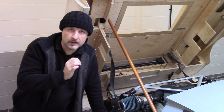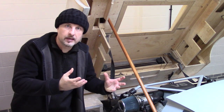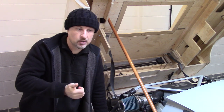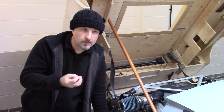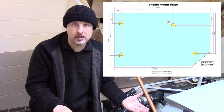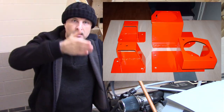One of the things I had to figure out were the engine mounts. To make this modular, I couldn't weld the engine mounts into the chassis, because if anyone wanted to build this car they'd have to hack into the chassis, cut out the old mounts, and weld in their own. So I came up with the idea of having a base plate built into the chassis, with changeable mounts that bolt to that plate, and then the engine bolts onto the mounts.